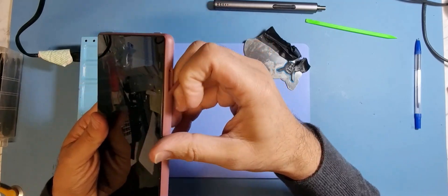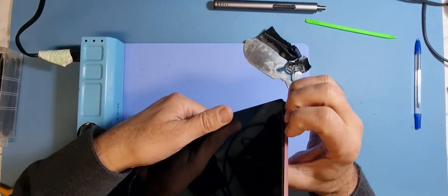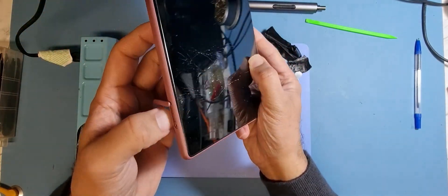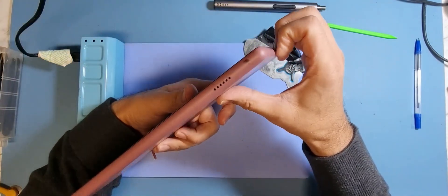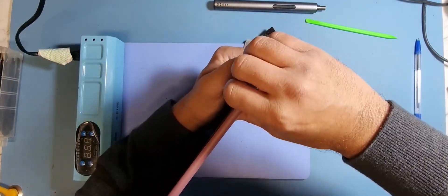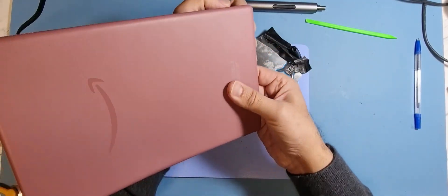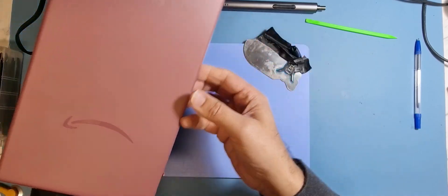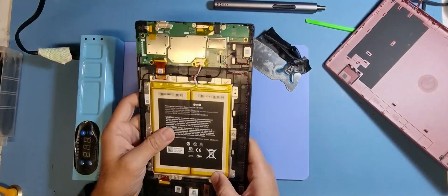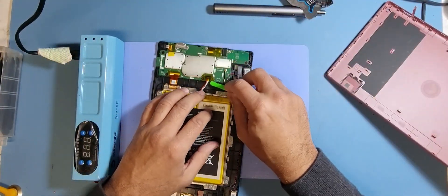Be careful there's no SD card in the device — there isn't, so that's okay. I always like to pull out the other side away from the SD card slot. I don't want the frame to get caught into the casing. I can even just use my nails and fingers and we're almost out now. Okay, there you go. Now let's look at the battery first with this pry tool.